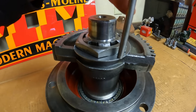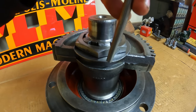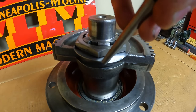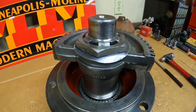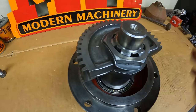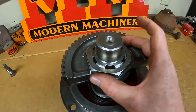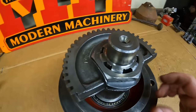Let's go for a second downward fold too — not so much because we have to, but because we can. We've got the internal splines plus the folded-up portion right here locking the nut to the shaft, but added insurance: the extra fold down right here is just more counterclockwise rotation prevention. Because if any of this is going to start rotating, it's going to have to climb up over the edge of the gear first. So it just locks it down even better.